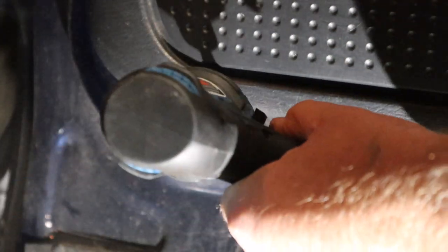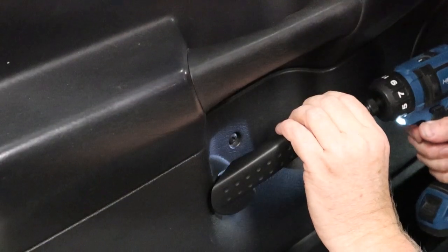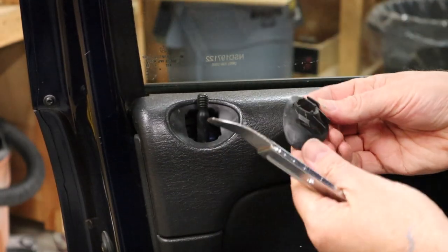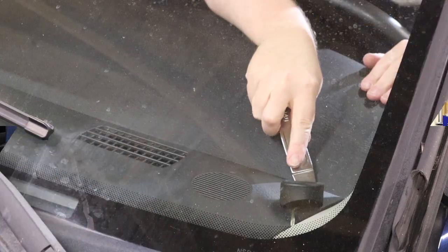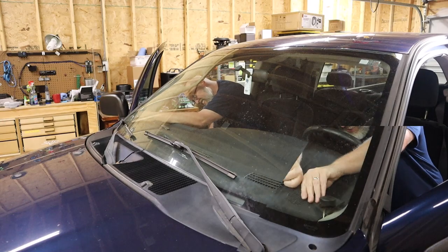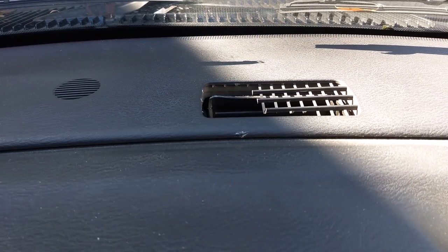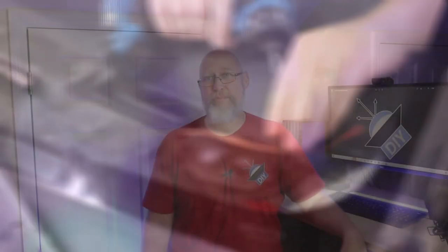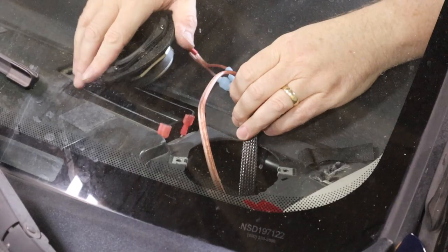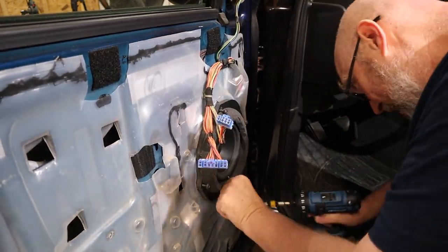All that's left is to remove the old gear and install these. One thing I like about this old truck is it is easy to work on. The doors are held on with four screws and all you need is a 10 millimeter to remove the door handle. From there you just pop off a piece of trim around the door lock, pop out the switches, and the door lifts right up. From the dash panel all you need is a pry tool — work your way along the back edge starting on one side and pull back towards yourself to release the front clips. Be careful because this plastic is really brittle especially on an older vehicle, and I actually damaged this piece last time. Using a right angle attachment on a cordless drill makes it a lot easier to remove the dash speakers. For the previous install I used waterproof quarter inch crimp-on connections — cheap, simple, and readily available at most auto parts stores. The old speaker adapters are held in place with four screws.